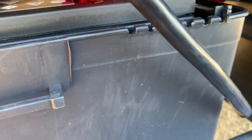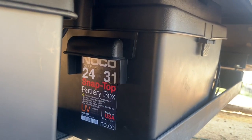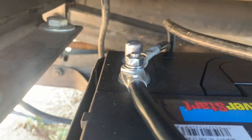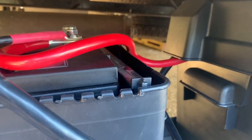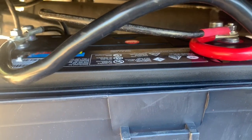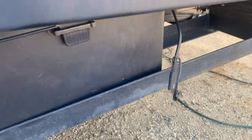With all three batteries in, the positive and negative run from battery one to battery two, then from battery two to battery three. The positive and negative of the last battery then run off to the circuit breaker on the toy hauler and up front. All three batteries are chained together in parallel — not series — so this takes all three capacities and adds them together. It still remains 12 volts, which is what the trailer requires, but the capacity is now three times that of a single battery.